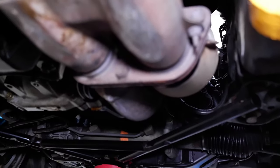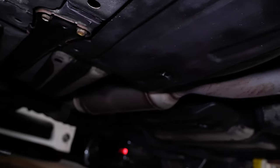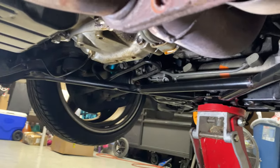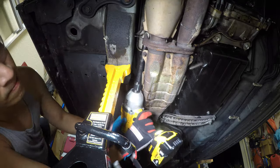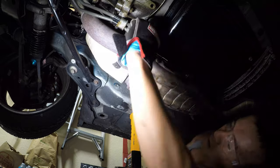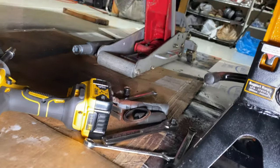My dilemma right now is I have to cut these exhaust bolts off because they're basically rusted. I'll attempt to shoot them off, but most likely I'm going to have to grind them off. The middle one I'll probably just leave, and I'll cut those off the car because the rear ones are spring loaded so they're not rusted and corroded. Got the first one off — shooting it off broke the head right off. I'm going to attempt the other two. The impact wrench made short work of those last two; they weren't as corroded as the first one that broke off. I'll end up having to replace those bolts, and the gasket kind of fell out too, so I've got to inspect all that.